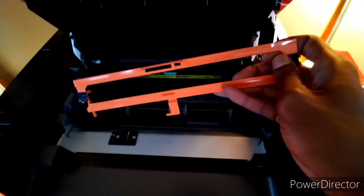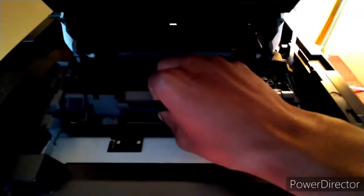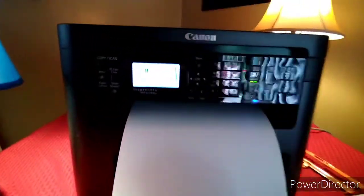When you take this paper off the orange thing, don't put it back in there or it is going to say 'toner not closed.' The electric part with the hole, the electric part with the little pole sticking out — you just line that up and this bad boy is sliding in. You will feel it snap into place, this will close all the way, and there we go. You can hear it doing its thing — it just printed me out a little test sheet.